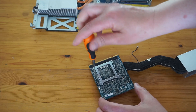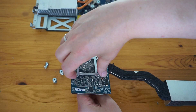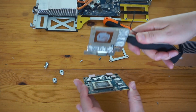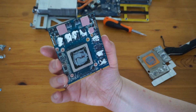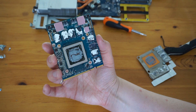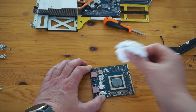There it is. Next we'll remove the heatsink from the GPU. I think someone has tried this before. These thermal pads apparently have never touched anything. I don't think they need to be covered anyway because the heatsink doesn't reach there — only the metal bracket does.